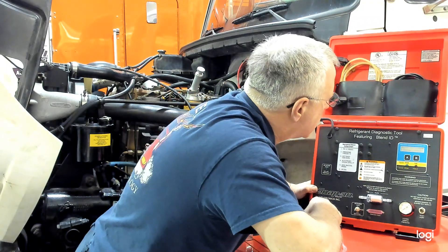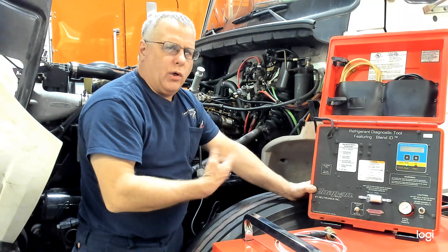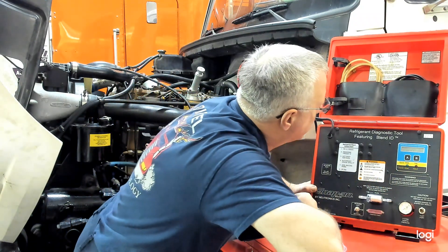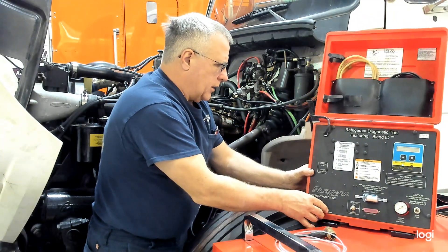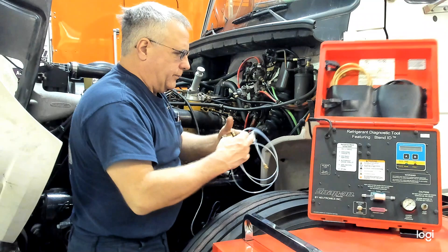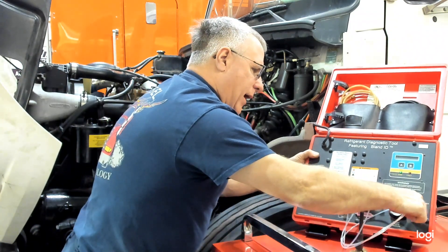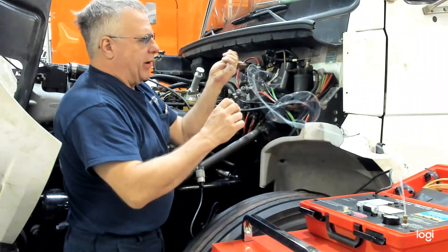Calibration's done. The next thing is to select the system that we have — is it R12 or R134A? So we'll press button A because we have 134A. Then we're going to connect our hose. Looking at our fittings here, we take the quick disconnect of the 134A type and make the connection to the port by hand. Then we will find our low pressure port.